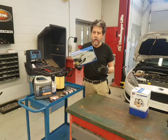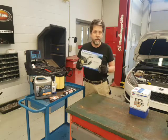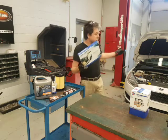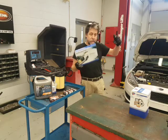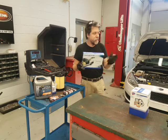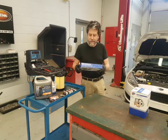My airflow came back big time — airflow on my face, on my feet, up on the windshield. I put the heater on first to thaw out the frozen part, and once it was thawed I turned on the air conditioning. It was beautiful — a $15 part. Lucky I caught it. I was hoping it wasn't anything to do with the heating or air conditioning or the blend doors. It was just a plugged filter. So if you've got poor performance on your vents, not a lot of air, you can hear the motor going but not getting a lot of air out, or your air conditioning stopped and got no airflow at all — check this. These are typically accessed in the passenger footwell, either by lowering the glove box completely or underneath. Use the internet or a repair information source to find where it's hiding.